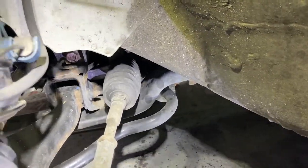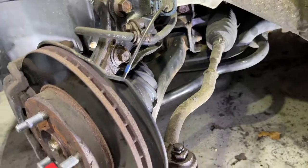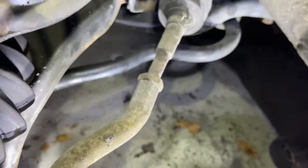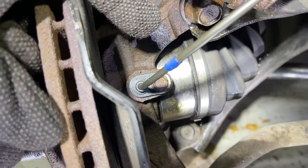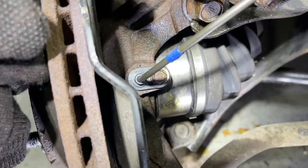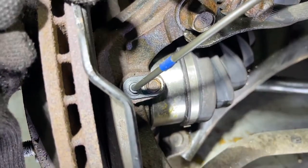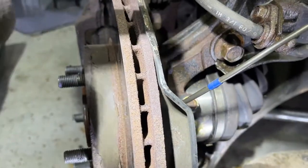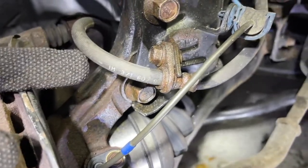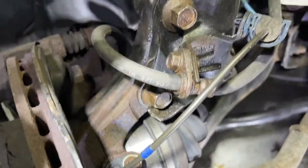The first thing you want to do is turn the wheel to the far passenger side — we want to work on this side first. I think the hardest part of this job is the ABS sensor. When you move the ABS sensor from the spindle, that plastic becomes brittle. It heats up over time and sticks into the metal, and I've had very little success removing them because they break. Turn the wheel to the far right, to the passenger side. I used penetrant on everything a couple days ago, so plan in advance and use penetrant on all the bolts that will be removed.